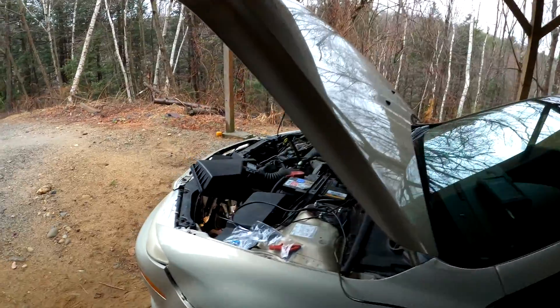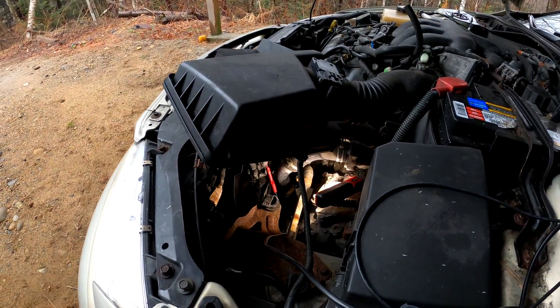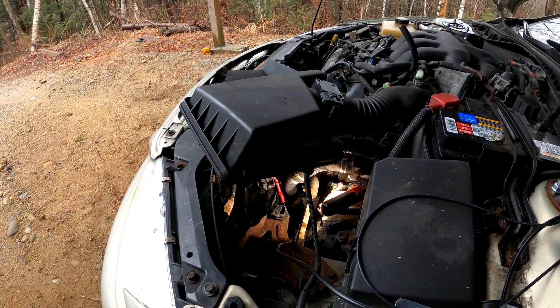You can hear in the background that the fans have come on quite high. We're going to shut the car off and I'll show you how I have the scope hooked up, just for reference. The next video will be on how to replace the radiator fan and control module. We're going to replace the whole assembly since those fans sound like they've got a lot of vibration. The car's got 200,000 miles on it, and it doesn't overheat at the moment, but the fans are quite loud.